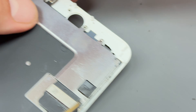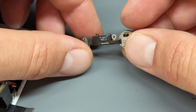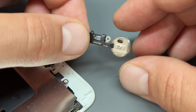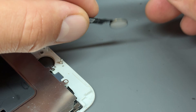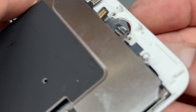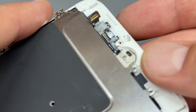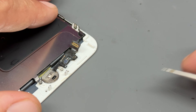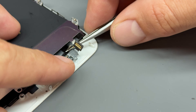When you're replacing the button it needs to be an original pulled button. I'm going to put links in the description for where you can buy all the parts used in this video. This is an original pull button from another iPhone 8 or iPhone 8 Plus — they both work the same. You can't use an iPhone 7 Plus button on this one, but you can use an iPhone 8 or iPhone 8 Plus button. Thread it underneath and into the hole.